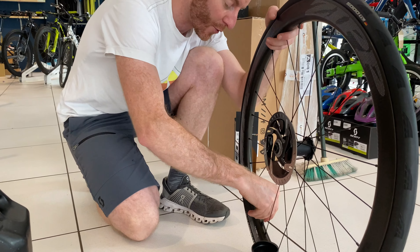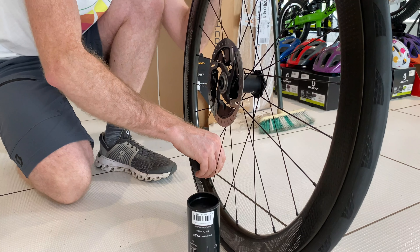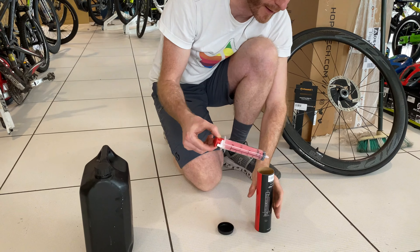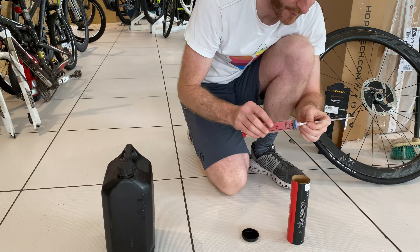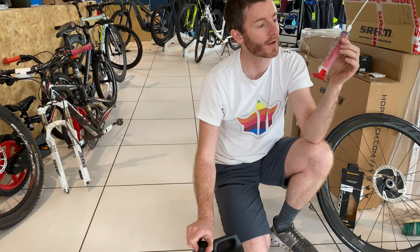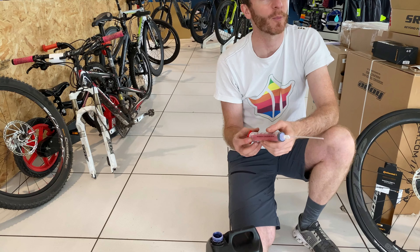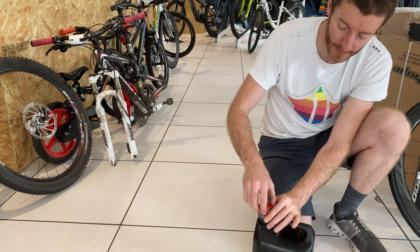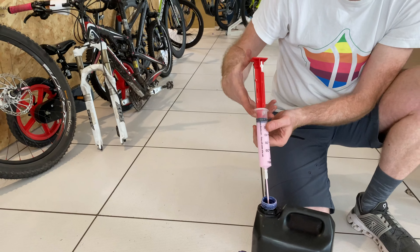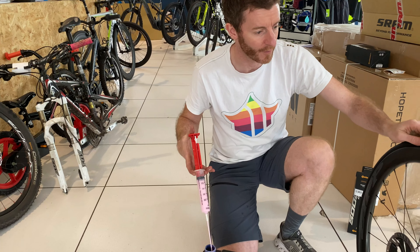Next phase: remove the valve core. Obviously if you've got a lot of pressure in there, it will fly off — just make sure you hold onto it. We find this Milk It kit very good, a way of keeping clean. Is that a Muc-Off product? No, this is a Milk It kit — it's got DT Swiss branding on it but it's actually made by Milk It. They do one-way valves, which are quite useful if you've got a really stubborn road wheel that won't stay up. And here's the Muc-Off sealant. I'm going to put double the dosage in because it's a new wheel — normally they wouldn't put this much in, but I'm going to put quite a lot because the tyre being quite soft will soak up a lot of it.